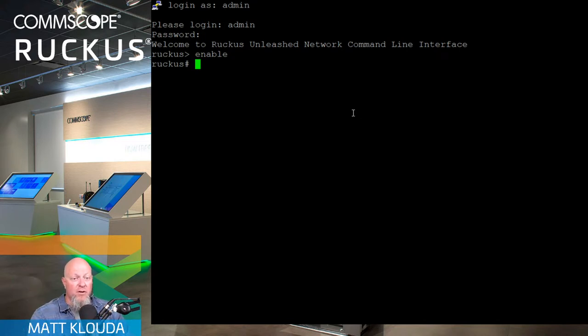And Walter, a good thing for you with this is if you have an IoT VLAN and you have a Ring doorbell or a Vivint front point, there's thousands of them. If you have a video doorbell, they only run at 2.4 gigahertz. They're old radios, and I don't know if they run at B or not. So I wouldn't do this on your IoT VLAN. But I would do it on the VLAN you use, your phones on, your tablets on, your laptops. That, I think you're probably safe. But if anything's B, don't do this.